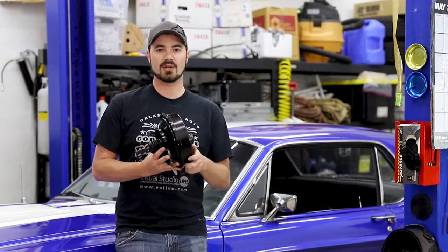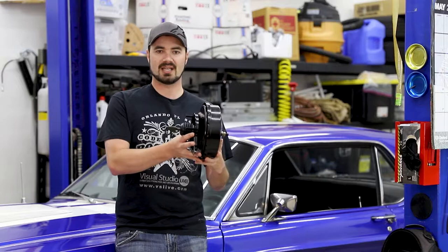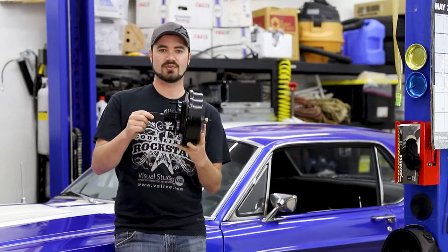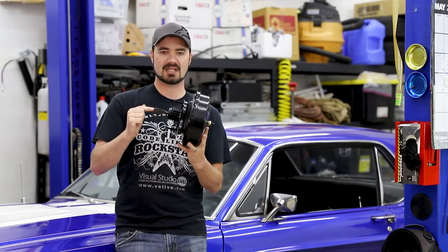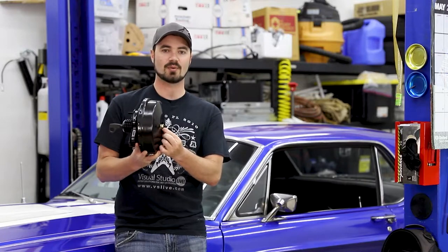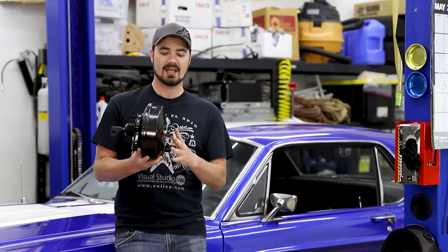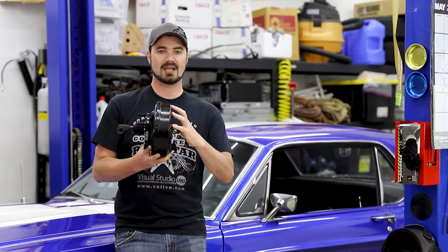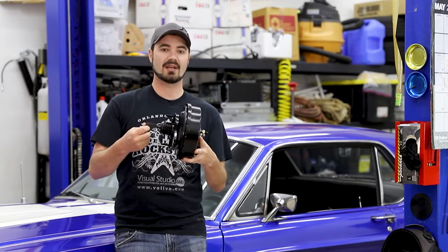For those who aren't familiar with a brake booster, it sits on the engine side of the firewall just inside the engine compartment and bolts to the firewall right here. This portion protrudes into the passenger compartment and hooks to the brake pedal. When you step on the brake pedal it pushes against this plunger which passes through a diaphragm and into the engine compartment where it pushes against the master cylinder activating the hydraulic brakes. In our situation the vacuum being applied to this side by the engine is causing a leak on the side where the pedal assembly enters.